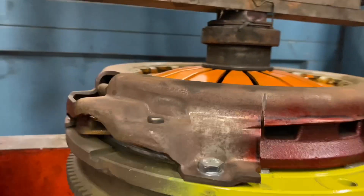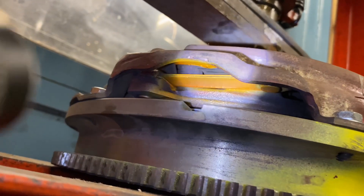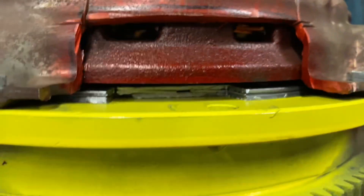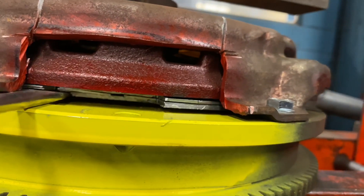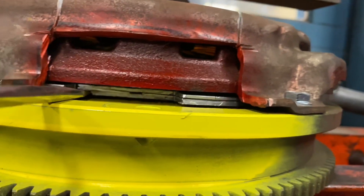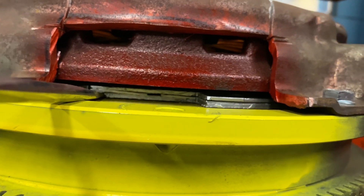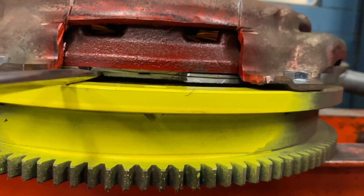Let's try this. You can see these fingers going down. As they go down, the orange bottom springs make the pressure plate move up. Now you can see the gap — and I can move the clutch plate freely. That's how when you press on the clutch, the clutch gets disengaged. The clutch plate doesn't spin at the same speed as your flywheel because it's just floating there — it doesn't do anything.